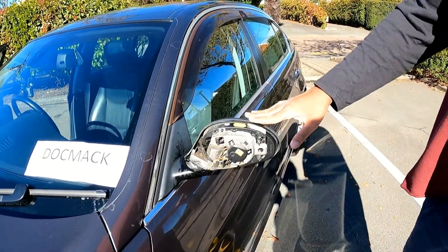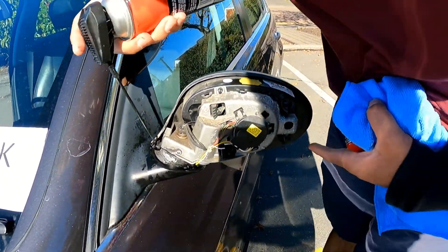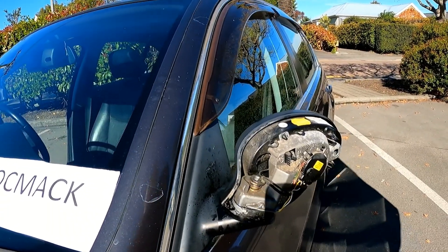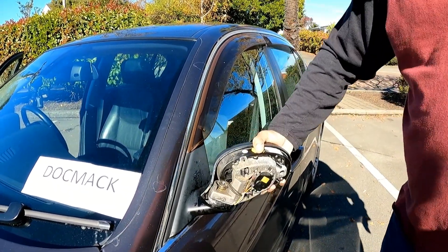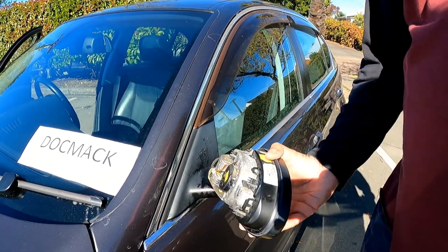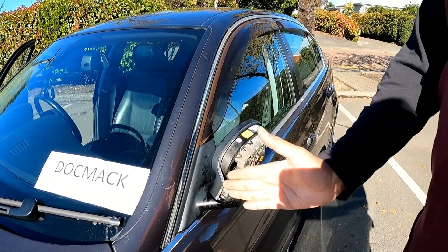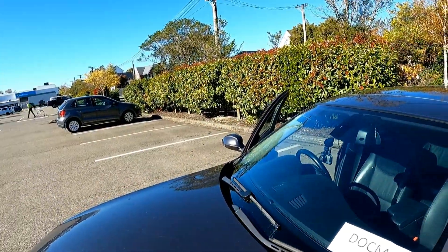The options you have for the mirror are bursts of WD-40 or some lubricant sprayed right at the home pin, which is located right here — that is where I'd actually sprayed some lubricant. I also sprayed some lubricant down this hole where I'm pointing. The way you can calibrate this: push the mirror all the way out, do the same on the driver's side, then hit the button and that's going to try to pop it outwards and recalibrate. If that doesn't work, while it's in that position push it inwards — same for the driver's side — then hit the button. It's going to fold inwards because it thinks the mirror is out. You'll hear a pop on this side and a pop on that side, and that's how it'll recalibrate.